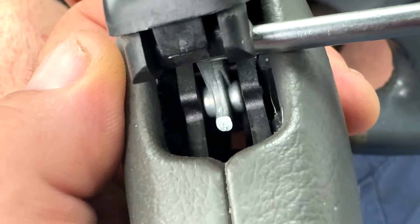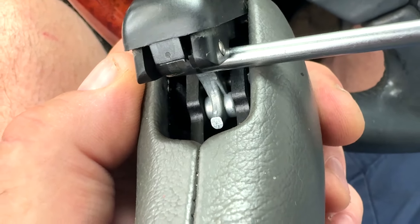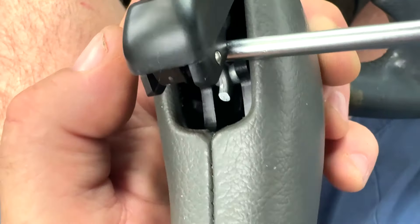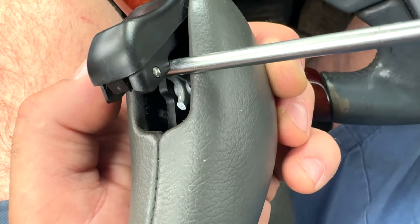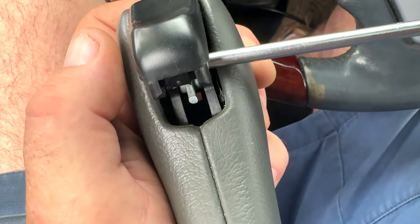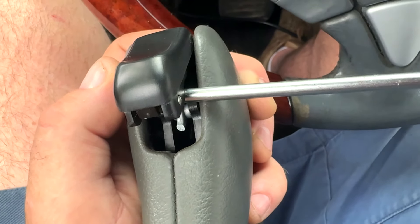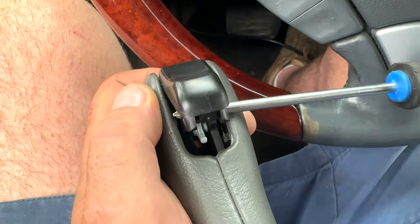I managed to hold it with a screwdriver — you can see where that's broken off. That is the little pawl I mentioned: it's got a little hook on it, about a centimeter long, and it pulls up. It's not going to do that when it's broken off, and there's no way to fix it — just need another shifter. A used one is fine, don't care as long as it works. Anybody got one, let me know — I'm on Facebook Marketplace looking for parts cars right now. Thanks for watching.